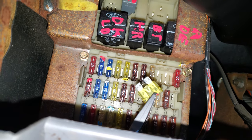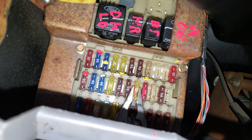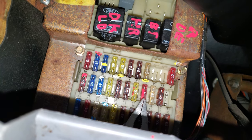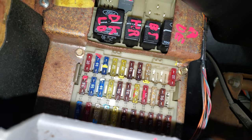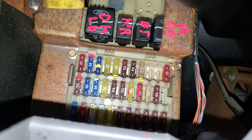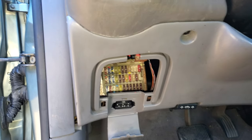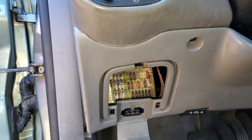So that is what a good fuse looks like. And the fuse for the OBD port, for the inspection, that's going to be right next to it — that 10 amp fuse at number 48. As you may notice, there should be a cover here; it's missing on this car, but it should just pull straight out.